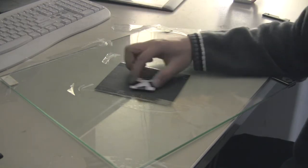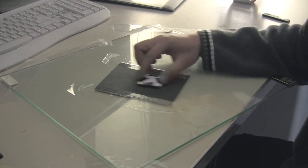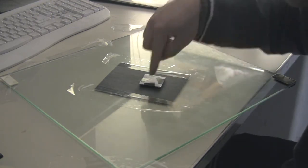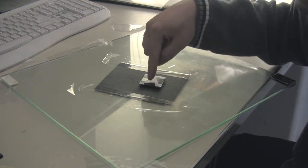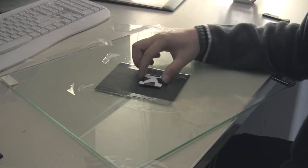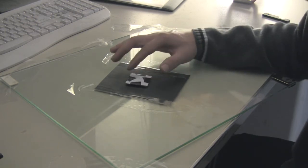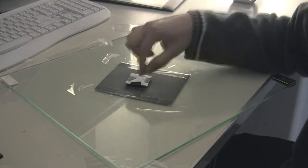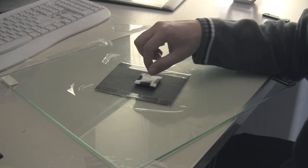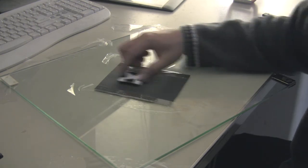Some people also like to go sideways, spin it around diagonal — you can do pretty much whatever you want. But one thing to keep in mind is you don't want to push pressure on top physically with your hands. You just want to push it side to side — just horizontal control — and let the weight of the CPU push down on it. Because when you're physically pushing down, you don't know if you're applying pressure evenly across the corners, and that might cause it to sand down unevenly. Anyway, just keep doing this.